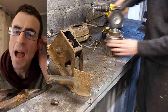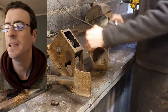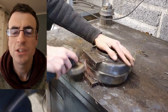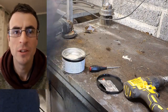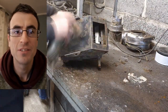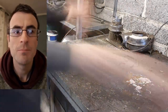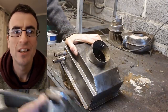The fan cleaned up and the fan housing cleaned up, and I found a fair bit of rust — you can see it here in this clip. I used body filler in two stages to clean that up after making sure all the active rust was gone. I came back with the angle grinder and wire wheel, which cleans up the body filler very quickly and left a pretty nice finish. By the end when it was painted you wouldn't actually know — plus it's hidden from view when the wing is on — so I'm really pleased with how that came out.